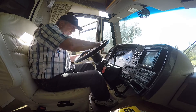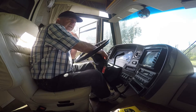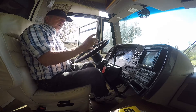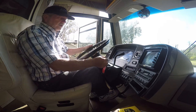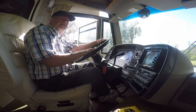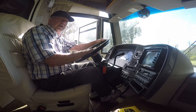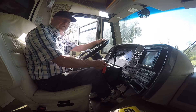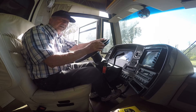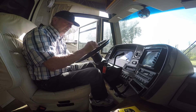Along with that, I didn't have flashers or brake lights. When you put the hazards on, I did not have any flashing — you can see nothing's happening. Also, on most motorhomes there's an electric assist brake: if you lose power, you can push the brake pedal, you'll hear a motor crank up. My electric brake does not work right now. So all of that went out from the two wires shorting back there.